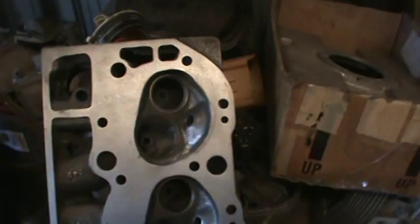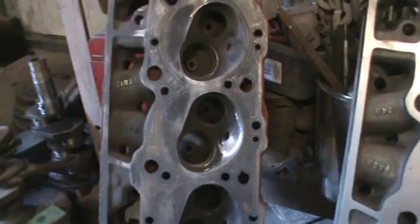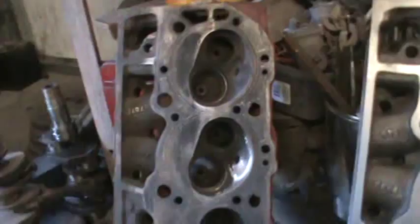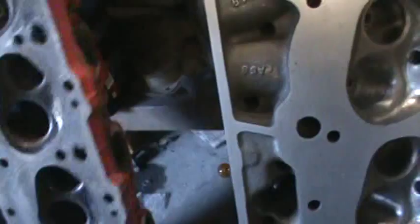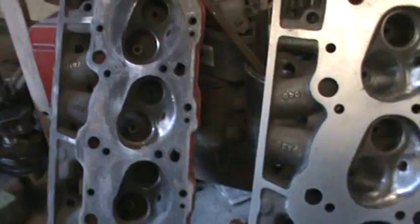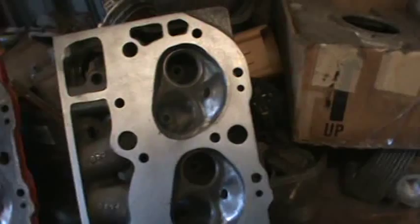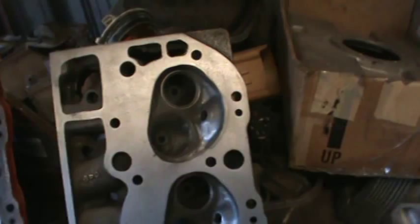This is a set of 781s. Personally, I know you want to use the closed chamber, but I would give you these heads if you want to pay the shipping. This is a good set of castings. The nice oval ports are almost gasket-matched to the Felpro gasket right out of the box. The water jackets are really nice on them, and this is a preferred head among some of the big block guys on YouTube. They would probably be better suited — you're going to have a much better piston selection. These have much better flame propagation than the closed chamber. Closed chambers don't have good flame travel and can be hard to tune on the street, especially with a 110 lobe center. It could detonate if you don't get the cam timing right.